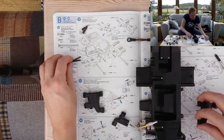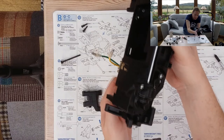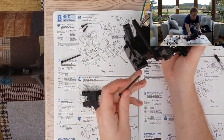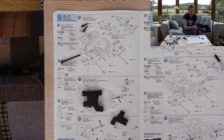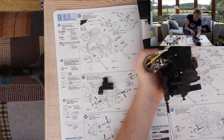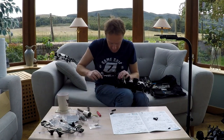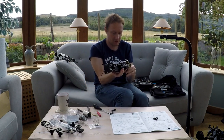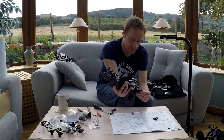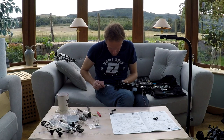What we want to do is use these big screw pins through there and send it to the chassis. It's only secured at one end - that slides through freely, then it's threaded on that side and bites into this bit. It's not easy to keep this all on camera - I hope you appreciate this. I'm predicting lots of slop. It's got a fair amount of slop, but not too bad actually. Maybe if I tighten that one up slightly more I'll eliminate it.